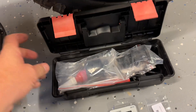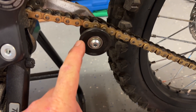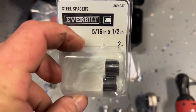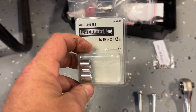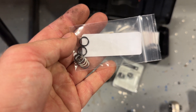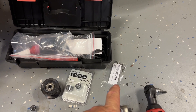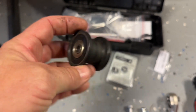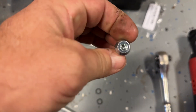We will go into our factory toolkit and you'll see you get this — a spare replacement for the lower chain guide. I have some of the stuff laid out. This is a 5/16ths by half inch long spacer you can get at Home Depot or any hardware store. These are skateboard truck washers — when you put new wheels on a skateboard, these go on the outsides of the bearings so that when you tighten the nut down it keeps the bearings from getting pinched. Those are like $4 on Amazon, about $5 at Home Depot. The chain guide comes in your RAR kit with a new bolt. The 23 Mantis had a 10 millimeter head bolt; the 24 bolt comes with Loctite already on it and takes a 5 mil Allen.